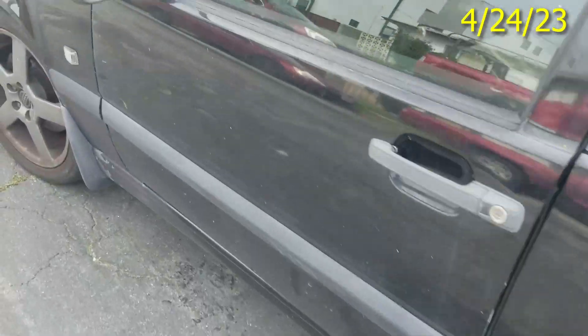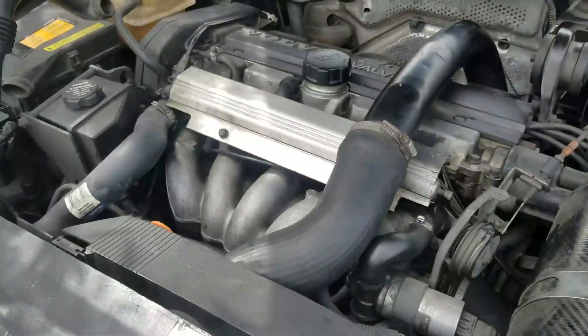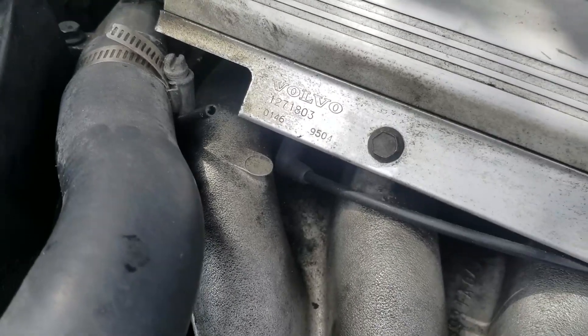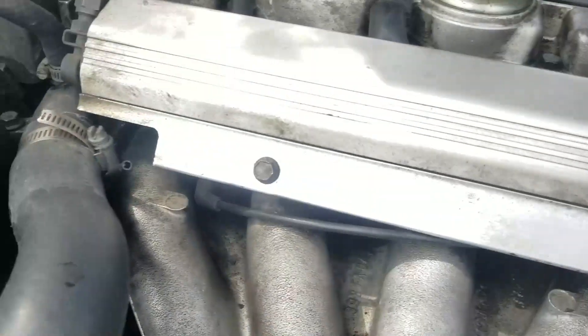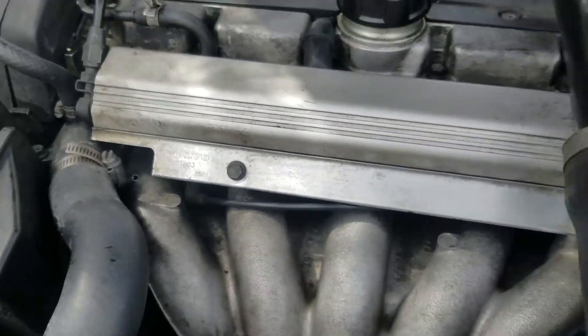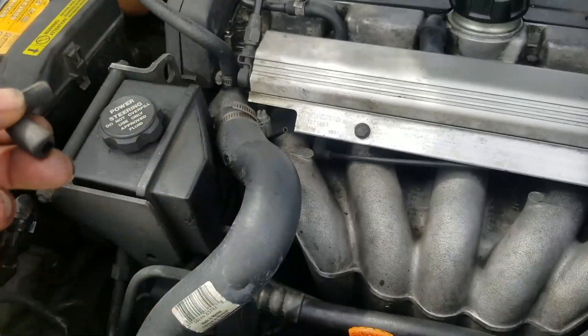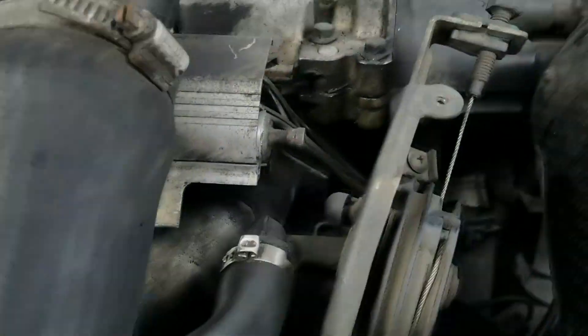Taking off the Tinker Day back on this T5R sedan and we're going to deal with this PCV hose. Last thing we saw was the end of that split. I was able to take the other end loose, push it through to get it up that far, and I have one of these Volvo elbows. I'm going to put that on there and try to get it on the end of that intake manifold so we don't have to remove the intake manifold.